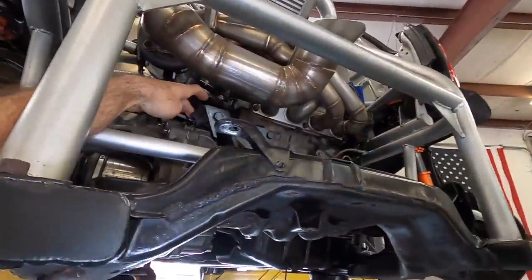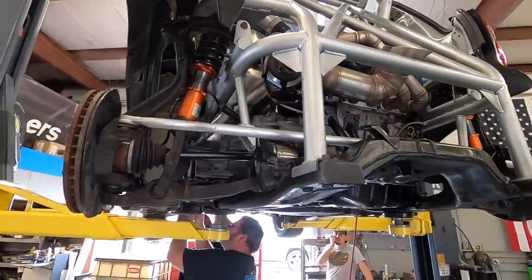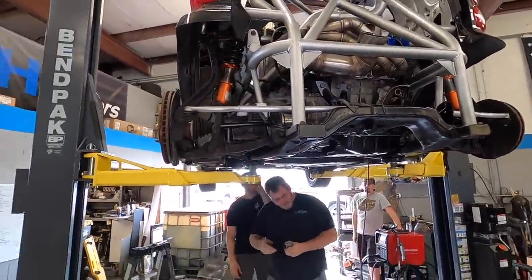Yeah. So we took what's coming off the valve cover, and then we took off the other PCV port, just ran it down kind of nice and clean. We want to be able to see if this thing is blowing out a significant amount of oil. Pretty much just like a really quick health check to make sure it doesn't have a terrible amount of blow-by, and if and when it does, we should know it pretty quickly.